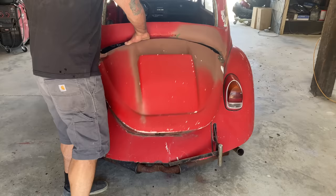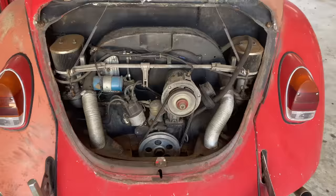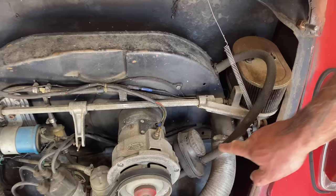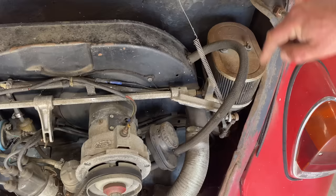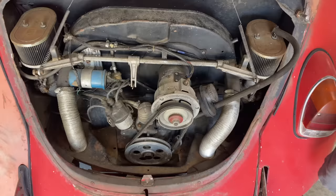One of those fiberglass things — but look what's beneath the surface. He said it was a fast car, says it's an 1835. A couple folks on the socials, Facebook and Instagram, said, why are they running the crankcase pressure into the fan shroud? You have positive pressure coming out of here and positive pressure coming out of there — I don't get it. They'd definitely be fighting themselves. This is meant to go into the single carburetor air filter, and that was for the emissions, I'm assuming.